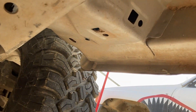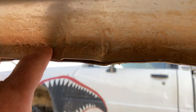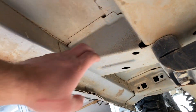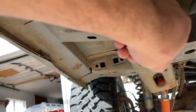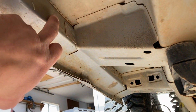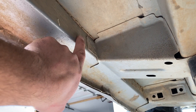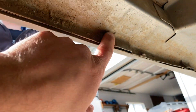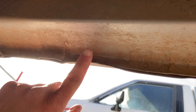So the next thing we're going to do is make a cut to this little lip on this bottom edge, because that's what holds the two body panels from the inside of the outside of the unibody. Cut that all the way down because this is a little different than a ZJ. It has these mounts that go from the frame where the mounts are on the crossmember and out to the rest of the body. So I'm wanting this to be the backing that we can weld the slider to, so that it takes the place of all of this. We're going to cut away this little lip so that the piece of steel tubing will slide in there and we'll weld the bottom seam to it — in theory.